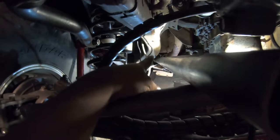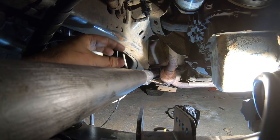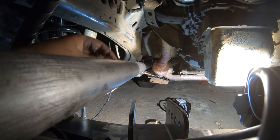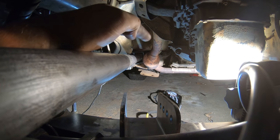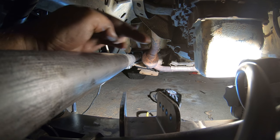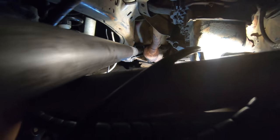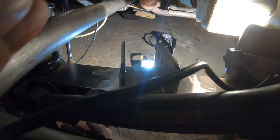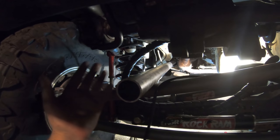The frame bracket is welded beside the catalytic converter — we have about half an inch of clearance and I think it's going to clear. I won't know until we flex it. Worst case, we take it to an exhaust shop and have them cut the catalytic converter off and move it about an inch toward the inside or middle of the Jeep. When it comes to welding up catalytic converters, I'm not a big fan — don't want to mess that up. So we're going to flip the axle bracket vertical, weld it in place, and then measure and build our upper link.